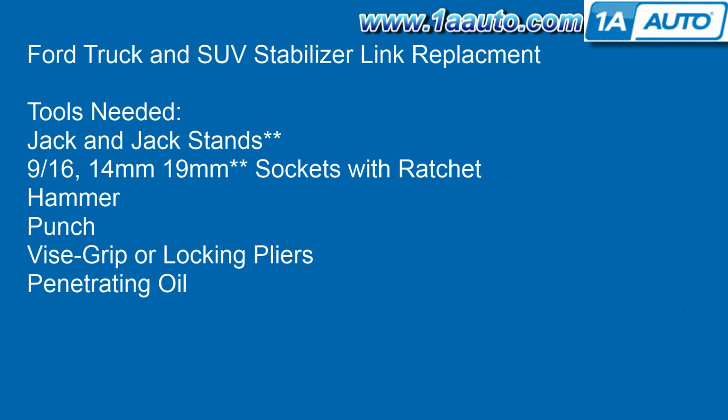Tools you'll need. I put jack and jack stands on here, but you can actually accomplish this with the vehicle on the ground. Obviously, it was a lot easier to film it with jack and jack stands, but you will need 9/16 and 14 millimeter sockets. The 19 millimeter socket would be if you're taking the lug nuts off. Ratchet and extensions. You'll need a hammer and a punch, vice grip or locking pliers, and penetrating oil. And actually those last four things are only if yours is rusted on there like ours was.